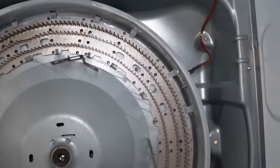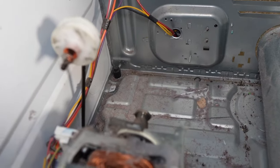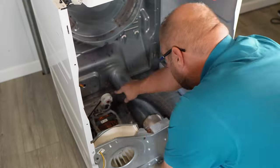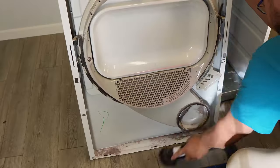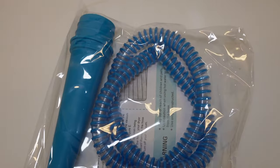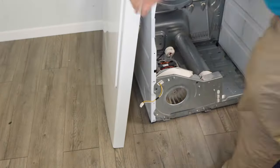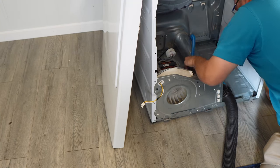With the dryer now open, it's time to inspect the heating element area, as it's a major culprit, as well as all the sensors. You would want to look for any physical damage or burn marks to anything on the heating element unit as quick proof that it is damaged. Now if the dryer was heating but not drying properly, chances are there's a lot of lint buildup inside the chassis or inside the door where the filter goes in. I'm going to go ahead and take precaution by cleaning the chassis out — the motor does feel like it's binding slightly due to dirt. I'm using a shop vac, but it's not going to get all the small areas. I would suggest getting a dryer cleaning kit that has a small flexible hose to get any of the small parts and areas, especially where the motor is. I'll have a link to the kit in the description.